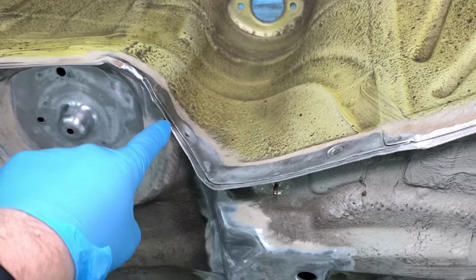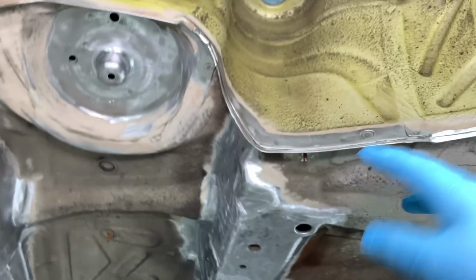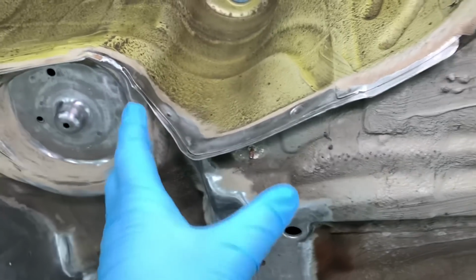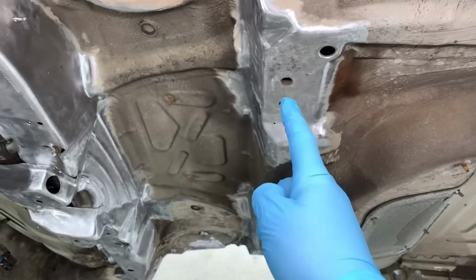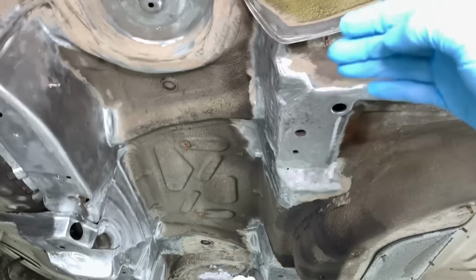And then we continue that all the way down until somewhere around about here, which just tries to help stabilize that panel, because it's just held on with 3 spot welds. It's crazy. One, the other one's there 2, and the other one's there 3. That's all that's holding that on. And in line with that rear axle beam, there's the left rear mount point, there's the right rear, that area there, the energy pulling down when you apply the throttle on this part of the axle is significant.